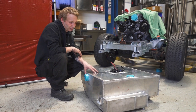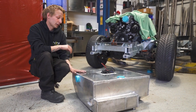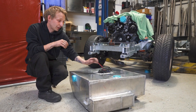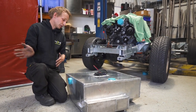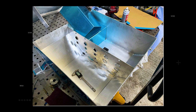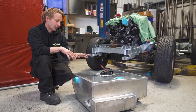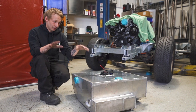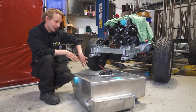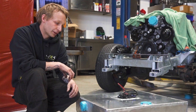So this is an aluminium fuel tank which has been made for Project Wombat. It is a baffled tank, so it's separated into six sections. We've got basically a wall with very small holes in it that stops the fuel being thrown around inside the tank. More importantly, when you accelerate, all the fuel rushes to the back of the fuel tank. And if it's not baffled and you have your pump in the front of the fuel tank, then for that period of time where you have your foot down and all the fuel's at the back, you're running the pump dry.